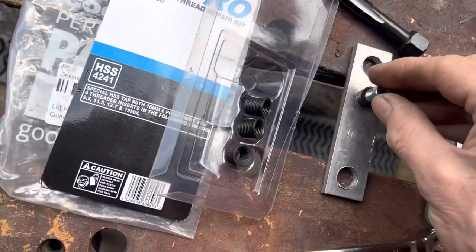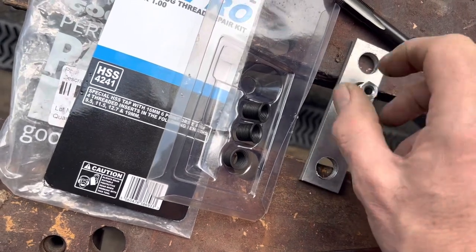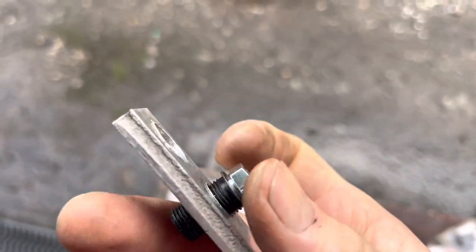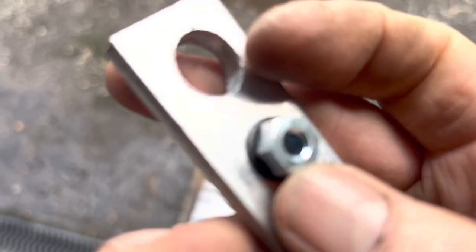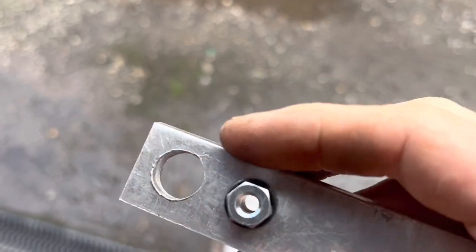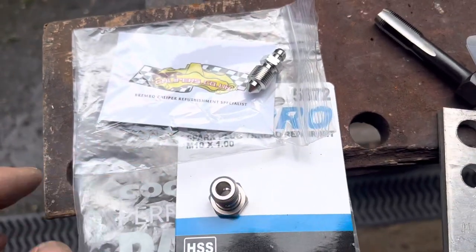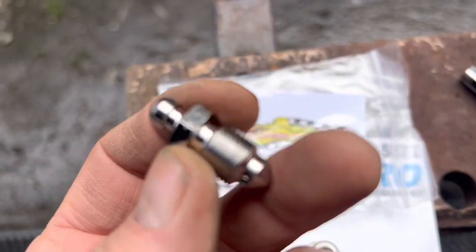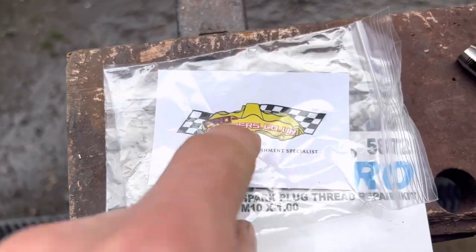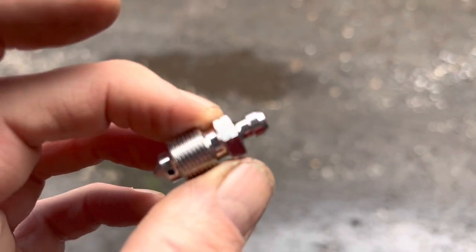To wind the time-sert in, use a spare male brake bleed line fitting — 10 x 1mm. We would glue the insert in as it has a lip on the top to prevent leaks. Before gluing anything in, it's worth noting that they do make an M12 x 1mm brake bleed nipple — we got one from ProCalipers.co.uk — so it may be that this actually screws straight into the M12 x 1mm hole we've drilled and does the job without any insert.